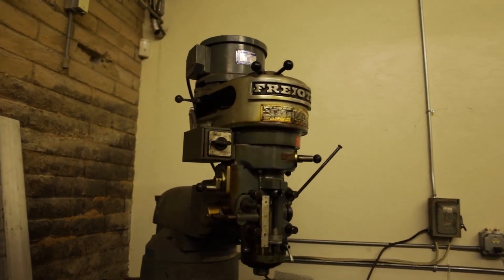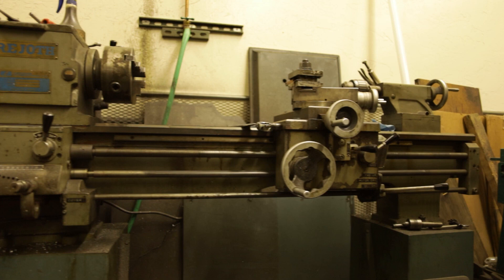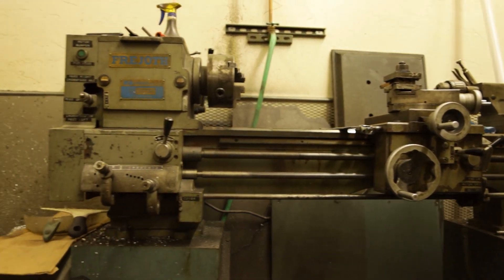We're going to get more into doing piston domes because there's a need for that. What we do is take a laser scan of a cylinder head combustion chamber, and that becomes the top of a piston. I can make a couple of adjustments for clearances so these things can operate at high RPM, and then with a little bit of programming we can make an exact duplicate of that combustion chamber on top of a piston to get maximum compression.